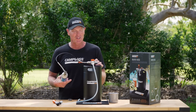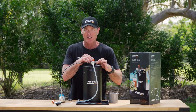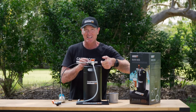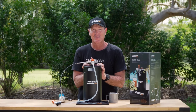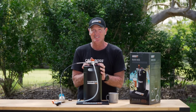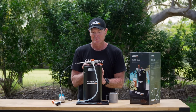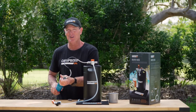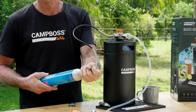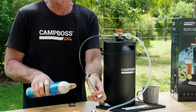So what we do first is we will dial our dial back here. See the dial? Dial it back all the way, okay, to off. Release the pressure till the gauge goes back to 0. That's it. Disconnect our bottle. Your soda stream bottle is now disconnected.